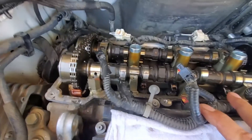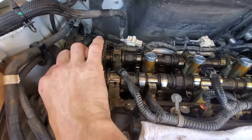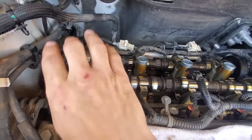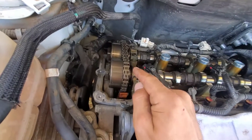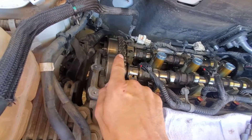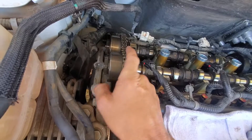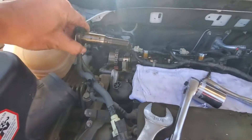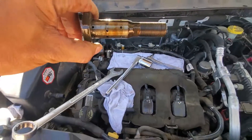As you can see, the cam is now loose. The only thing holding it in place is the oil control valve. What I'm going to do is loosen this bolt off and lift the cam and pull it back while keeping the phaser in place, so I can set it right down where it's got to go. That way I don't completely lose timing or chain tension. Also, if it does end up coming out of timing, that's why you put the paint on the chain — to make sure you can put the indent in the exact same marked position. This is your oil control valve bolt; it goes into the front of the camshaft and into the phaser. You can see it's got a bunch of holes in it — that's why it's called the oil control valve; it allows the oil to move through.